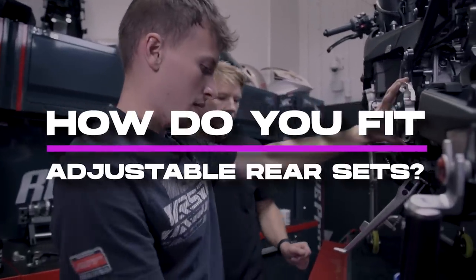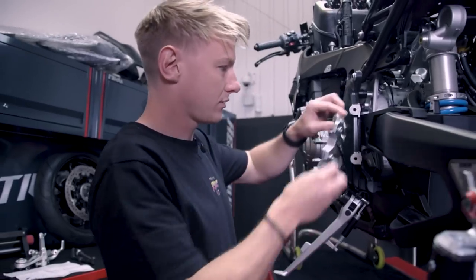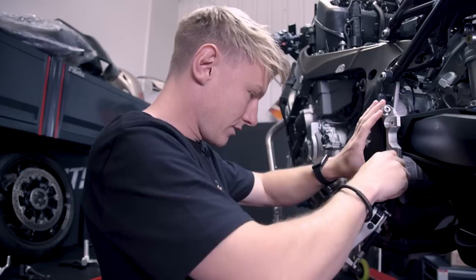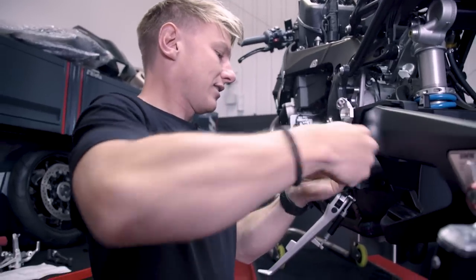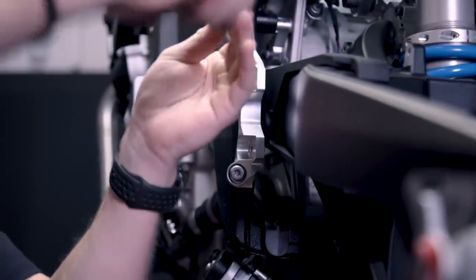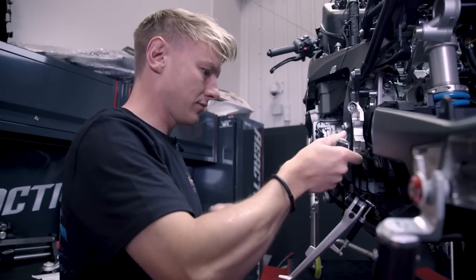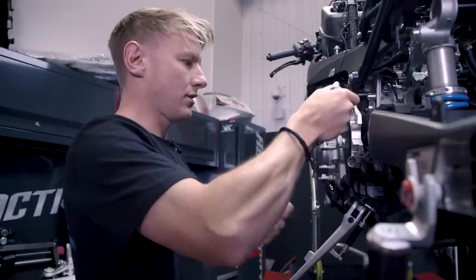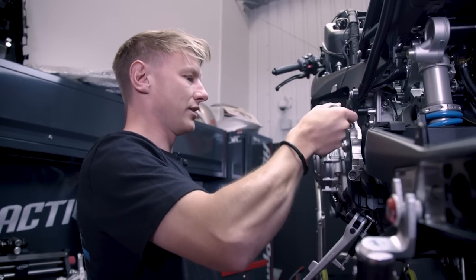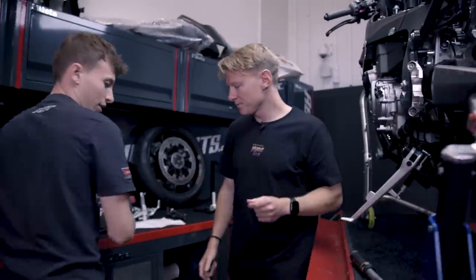Foot pegs — so just put that on there. Those two bolts screw in and then tuck it up. You've greased this bolt as well. I've greased the bolt. What are your thoughts on me being a mechanic, Macaulay, in the team? You've got potential. Story of my life. Right, I'm tucking it up. Tuck it up — 20 Nm. Do the Macaulay check. Nice. As easy as that. Now you can go and do the other side.